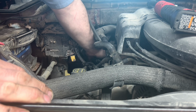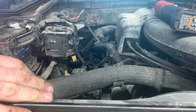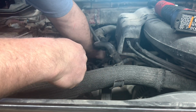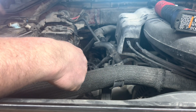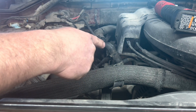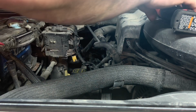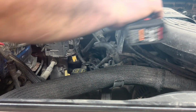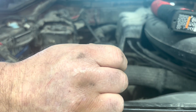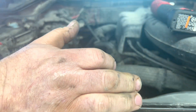Work on that sleeve so that it gets all the way down in there. That way you don't run the risk of getting anything out of line. Now, I choose to cut this by hand. I see most everybody uses a power tool, air tool, to cut those threads. It worries me. So I do it the old way.